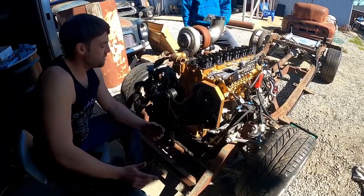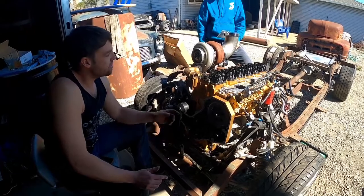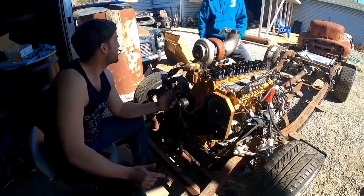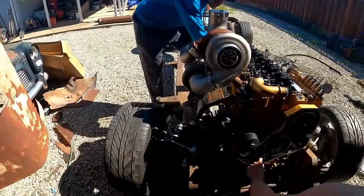The next step is basically to rotate the engine counterclockwise. If you're going to do that from the flywheel like I am, you need to rotate the wrench clockwise. So I'm going to have my assistant go ahead and do that while we watch the timing marks on the crankshaft.